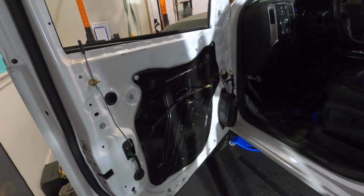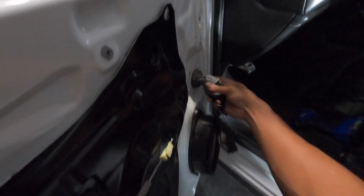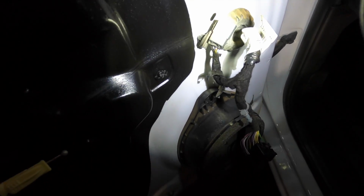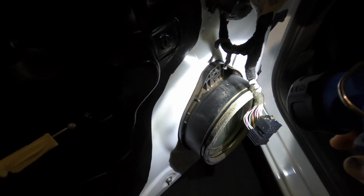Take off the interior door panel of the truck. We're gonna push the harness through the door. We also gotta remove the speaker. 7mm screw here, along with this portion of the harness right here. Push that down. Rotate this clip down 90 degrees. There we go. So you rotate that pink latch 90 degrees, that clip will come out the door. You push it back through here, take that out, push it down into the speaker cavity and pull the whole thing out.